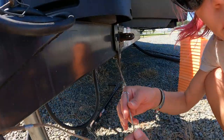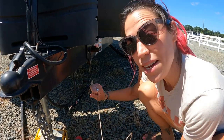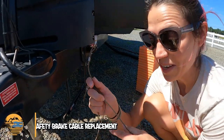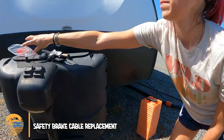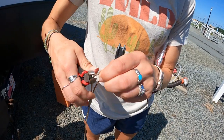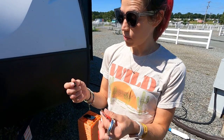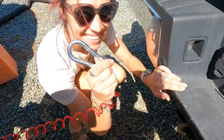Being that we're going to be on the road on a loose plan for the next few weeks, we just got the RV maintenance done and there are a couple of small things we need to take care of before we hit the road. First thing is our safety brake cable — it broke, so we have to replace it. If you don't know, the purpose of this cable is that if your RV becomes disconnected from the truck, it'll pull a little safety pin and automatically stop the brake so your trailer doesn't roll away. It doesn't do you any good if it gets old, rusty, and breaks, which it just did. Thankfully we had been keeping an eye on it because it was starting to look a little rusty.